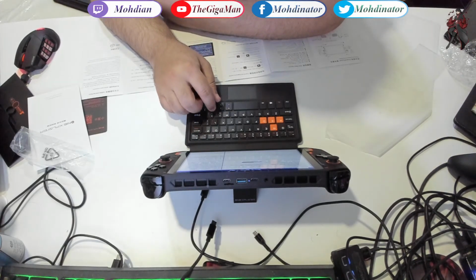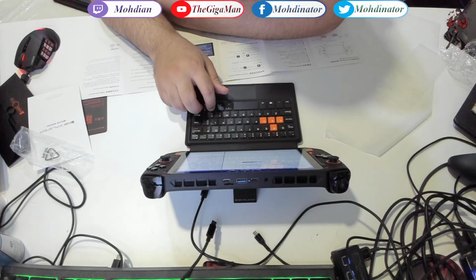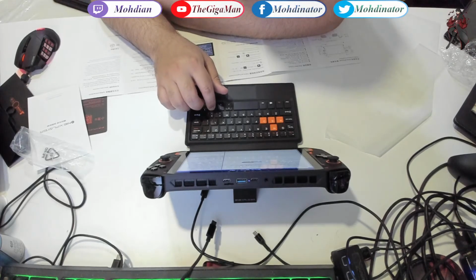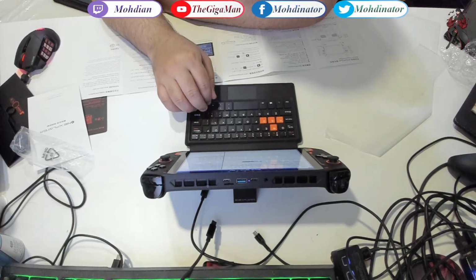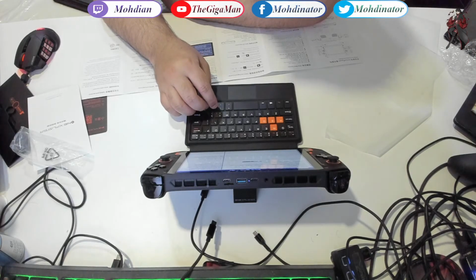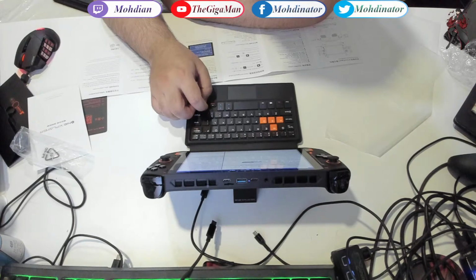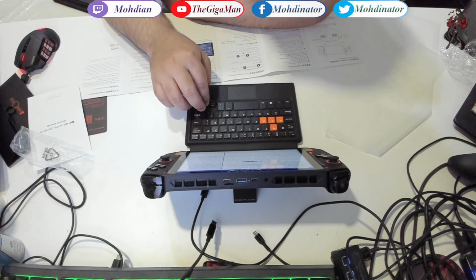Wait, so power limit 1, okay. Power limit 2 value in milliwatts. Power limit 1 value in milliwatts. BIOS will round to the nearest 1/8 of a watt when programming. 0 equals no custom override. For 12.5 watt, enter 12500. Okay, this is an example.